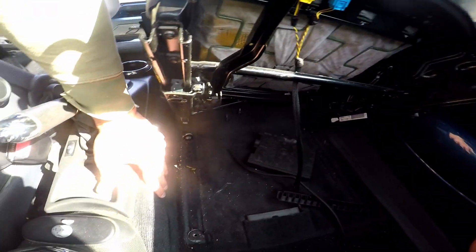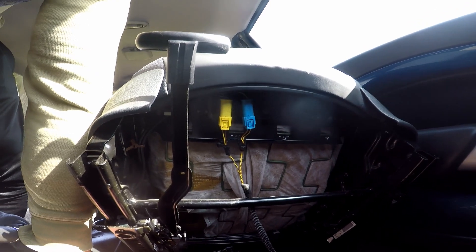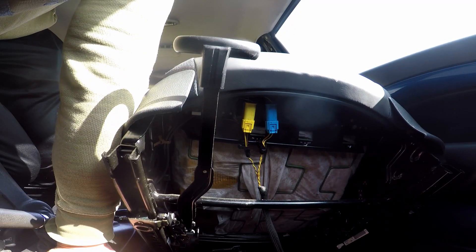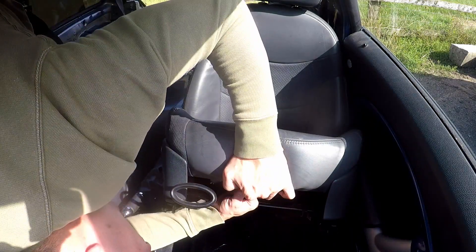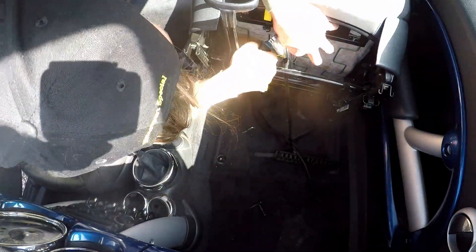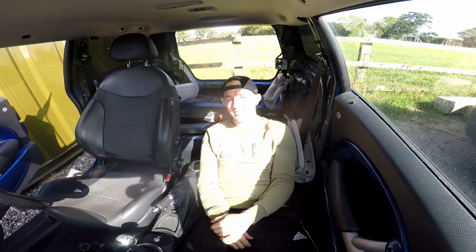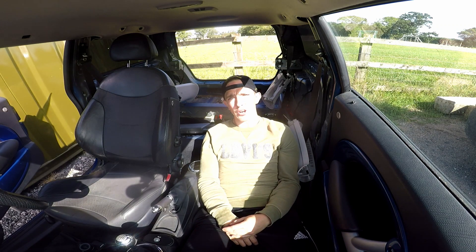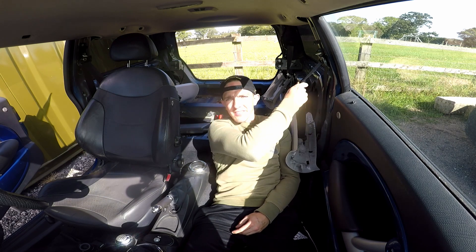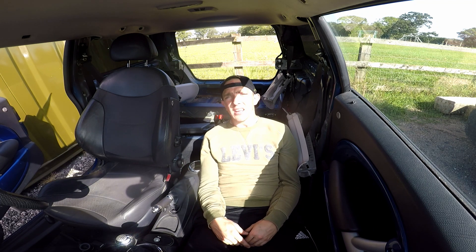That's the seat undone, just those four bolts. Then you've got the two airbag harness clips to take out. Obviously make sure you've got your battery disconnected and it's been disconnected for a good half an hour to make sure that the electricity is dissipated. So I'll just whip these two plugs out now and then try and take the seat through the boot. This is definitely an improved leg room space, at least that's for sure. These bits are going to get the seat and the belt still in - just waiting on a Torx 50 bit.